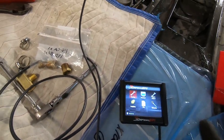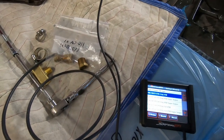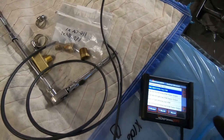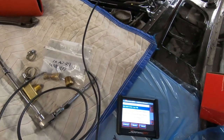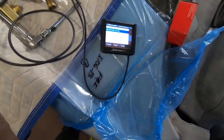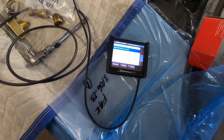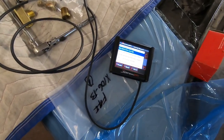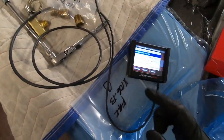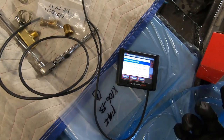So this was actually really easy. When you first turn the system on for the first time, you go to wizards — it's going to ask you a whole bunch of setup questions. It's pretty straightforward, so you just select the type that you have, hit next, it's going to ask you how many cylinders — 6, 8, 4, whatever you got. Next, then ignition type — coil or ignition box, points, next, or no control. It will ask you if you have a target idle, which I had to readjust. I originally had this set to about 800, which was quite high.